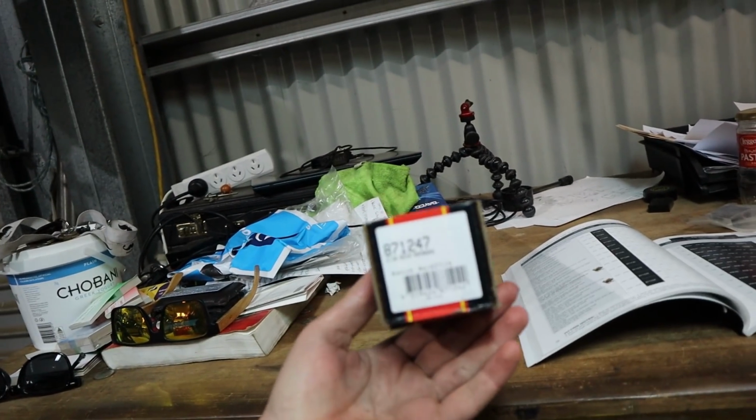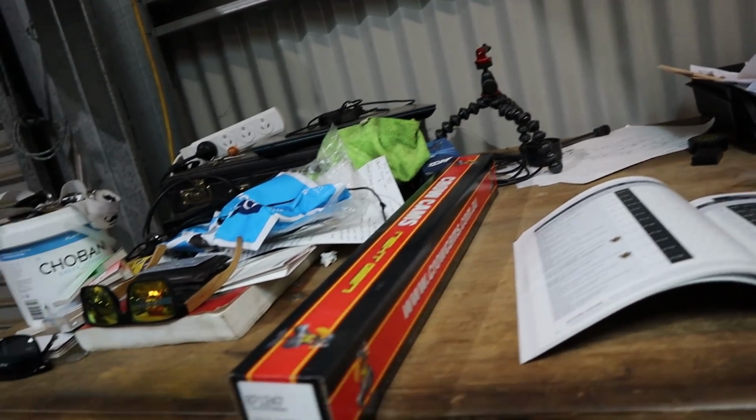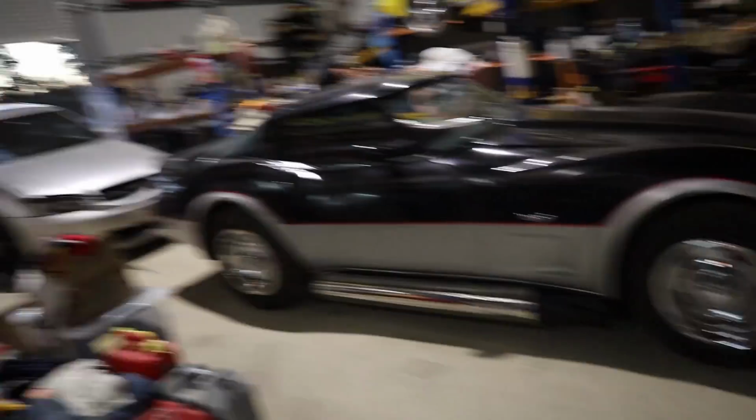So being that only sort of 580 lift is plenty enough, especially with this shorter duration, is no problem for us taking 40 thou off these heads. This should be a pretty good combination to get some good results out of this thing, but still have it a very good touring vehicle and towing vehicle being a manual.